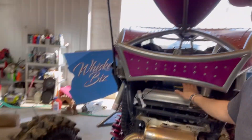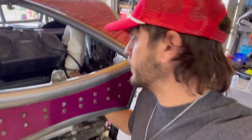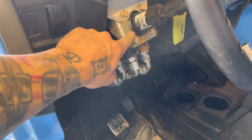Moving around to the back, I mounted my cooler in here. The reservoir is in here too — I found out that this needs to be at the highest spot possible. The cooler is here, and the orbital valve — I went with a 200. Originally I put in a 125. The 200 worked better for me because all the riding I do is slower, like mud and bounding courses. I'm not doing anything like 60, 70, 80 miles an hour, so I wanted something that reacted really fast.